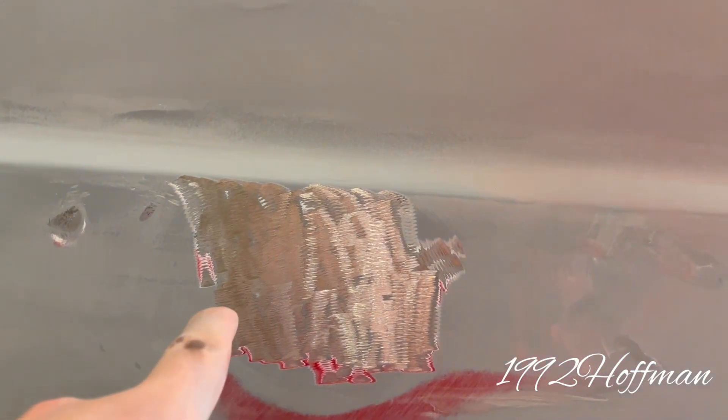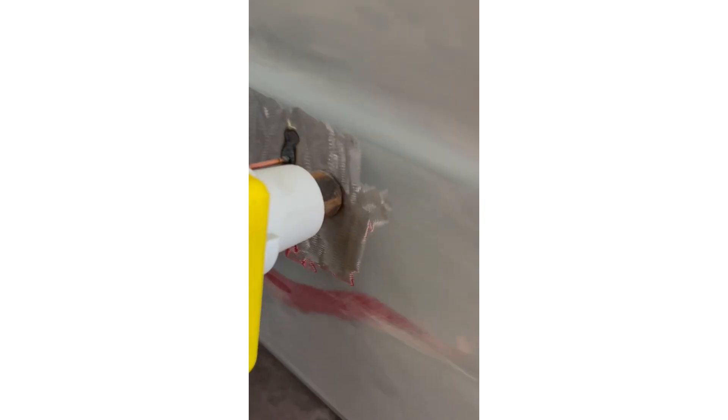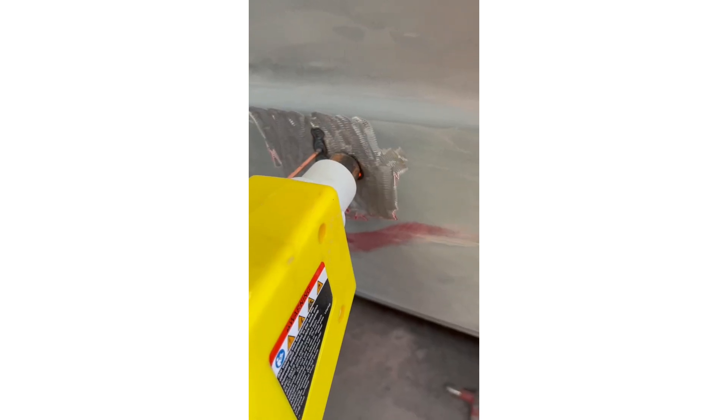Give me just a second — we'll shoot some studs into this and start pulling it. Now, how this works: you can see there at the bottom there's a little reset button. Go ahead and hit it, and here's your button on the back that's going to make it weld. You can see it welding now, then you just pull it off and you're good to put your dent puller on there.